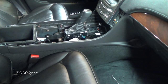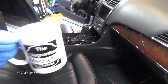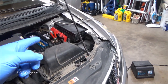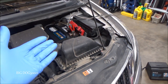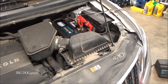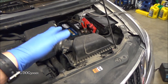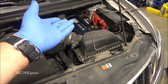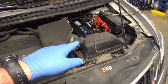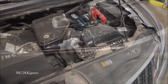We'll grab the new part and get this thing fixed. It's the next morning — starting the day off with some coffee in the disgruntled mechanic coffee mug. I've got the charger on. One of the issues when these switches go bad is that it drains your battery because the modules stay awake looking for you to put it in park, and they're not smart enough to go to sleep after a while, so it will kill your battery — that's what's been going on with this vehicle. Because I'm charging it with the key off, the battery monitoring system will need to be reset, so I'll do that with a scan tool after I'm done.